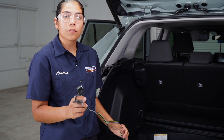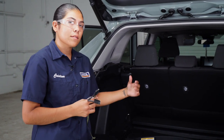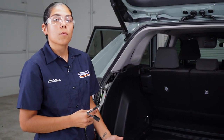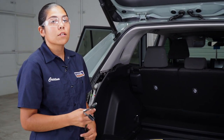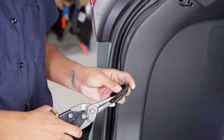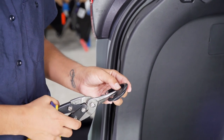There are two ways to route your four-flat wiring: you can leave it inside the cargo area and pull it out when you're ready, or you can run it on the outside of the vehicle towards the hitch. We're going to be running it to the outside of the vehicle. We're going to route our four-flat wiring through the same rubber grommet that we brought the power wire up with. We're going to reinstall our grommet — we're going to want to cut a slit for the wires to sit in and then replace it back in.